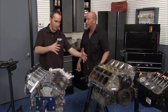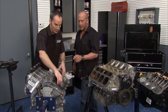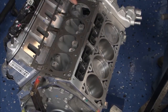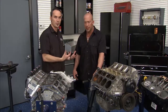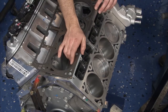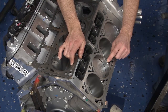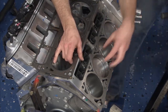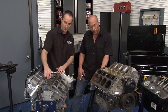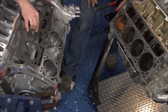So we've got some growing here — getting bigger and bigger in displacement. No replacement for displacement for making power. The earlier blocks are all cast iron, but these are aluminum. They make iron versions too in the trucks, but the aluminum ones are great for performance guys up to a certain point — nice and light to keep the front end from getting too heavy. These are sand cast and they've got iron liners cast right in, so all they have to do is start machining. You can also see the differences in head gaskets — this is an old graphite-layered one, and this is a multi-layered steel gasket. That's the newer technology, which is really nice.